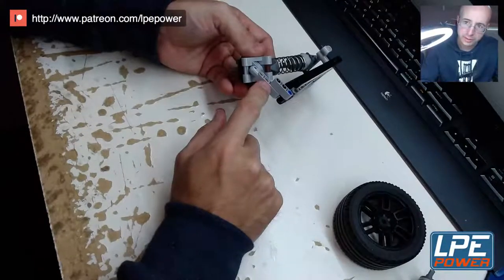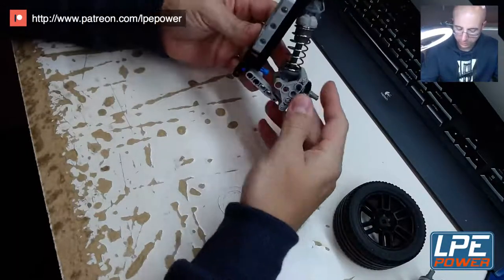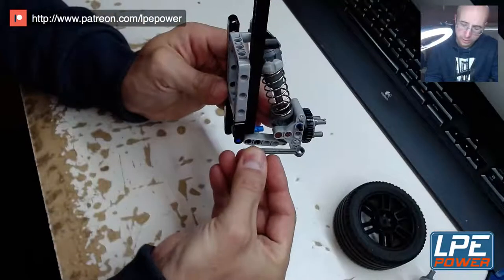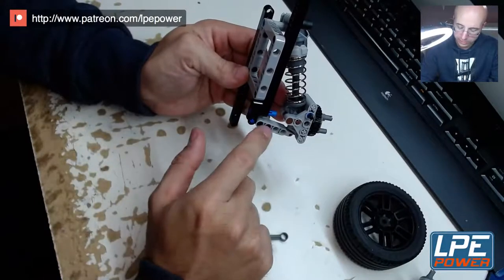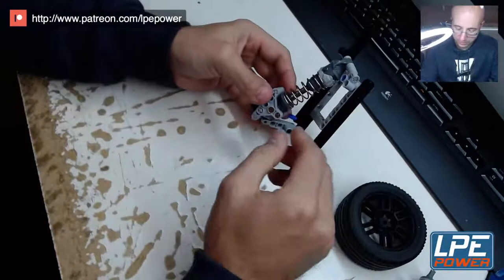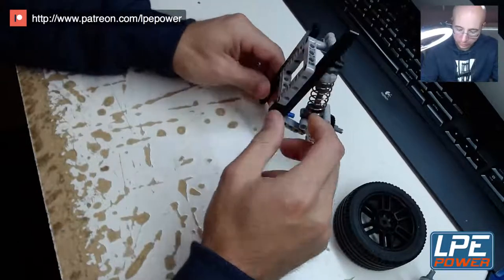And we're just gonna make this triangle somehow. I don't know how yet, because we need the space in the front here, because here in the front is going to be the steering rack. Steering rack, so we cannot have any suspension components beyond this point. Beyond this point, we have just steering. So everything regarding anti-roll bars, triangles, is gonna be behind the wheel. That's the plan.